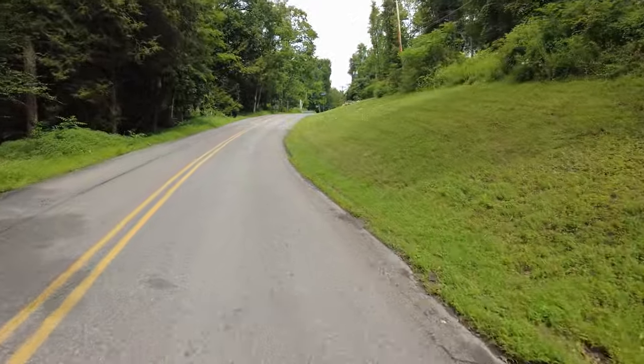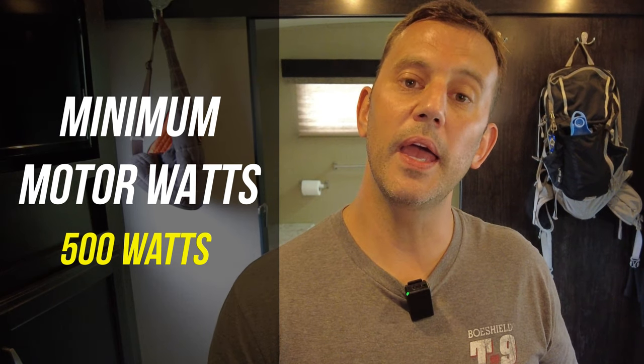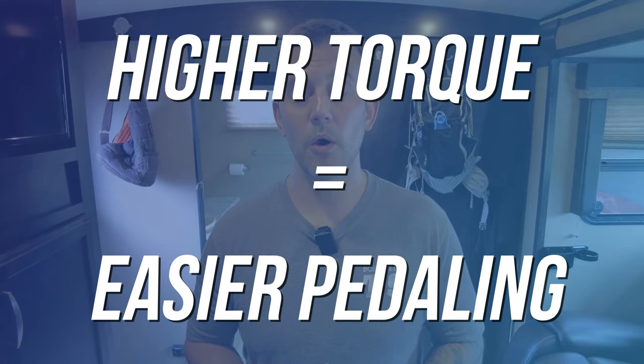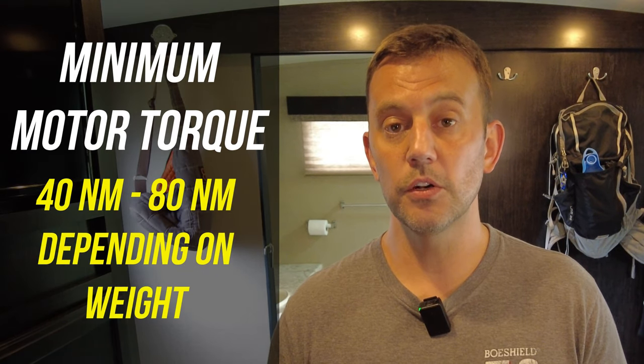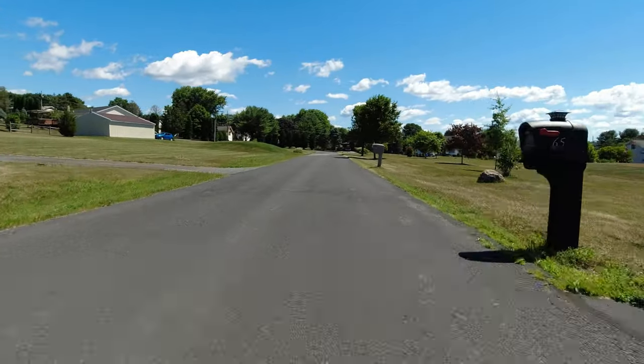Let's talk about the e-bike motor. Higher watts mean more power, faster response, and a better ability to climb hills at speed. It's easiest to understand watts if you think of them like horsepower on a car. From all the research I've done, I would recommend getting a motor that has at least 500 watts, especially if you weigh in the 250-pound-plus range. Torque is also important when researching e-bike motors. Torque on e-bikes is measured in newton meters, and more torque means more power and more powered assistance while pedaling. Road bikes should come in between 30 and 40 newton meters, while heavier bikes like trail bikes and cargo bikes should measure in around 80 newton meters.